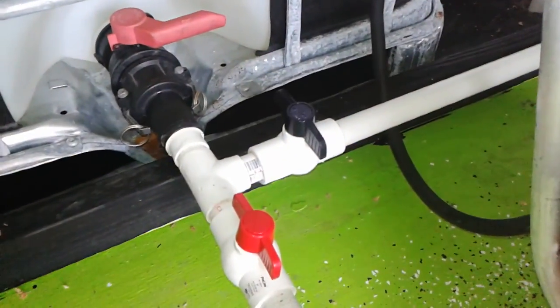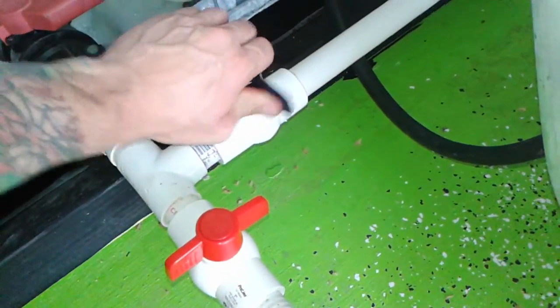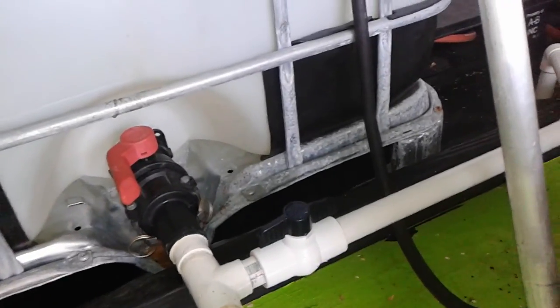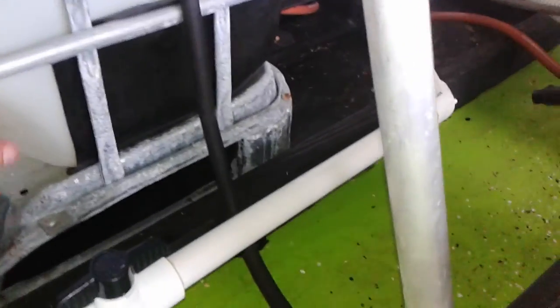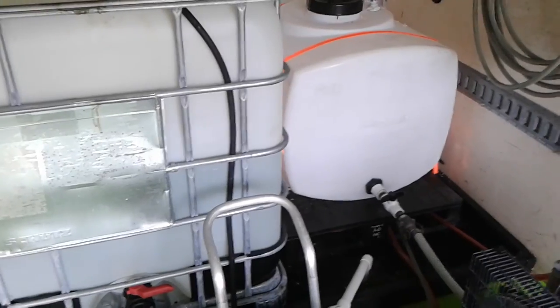Here's how I have the tank dump set up. If I want to drain my tank, I close this ball valve, turn this one open, open this one — and now I've got water going through this one-inch pipe pumping out the bottom of my tank. It's a 275-gallon tote, so it'll take about 15 to 20 minutes to empty. When we're doing long drives and don't need to haul 270 gallons of water with us, it makes a lot of sense. It keeps everything nice and dry the way I like it.